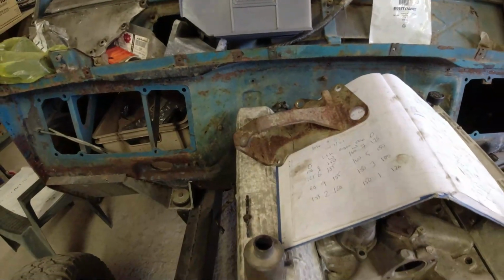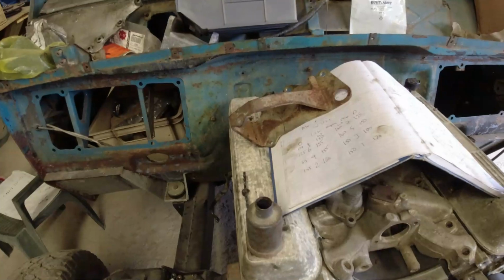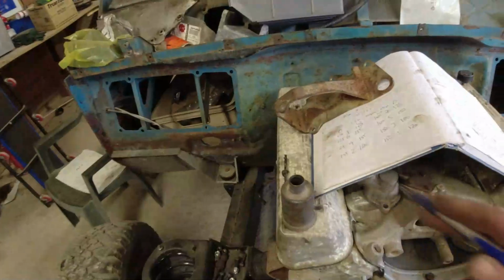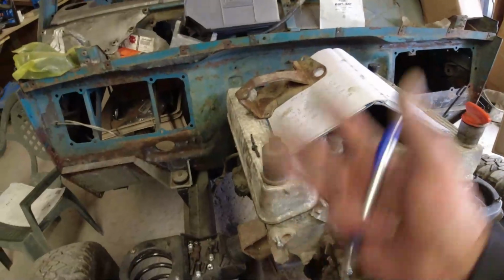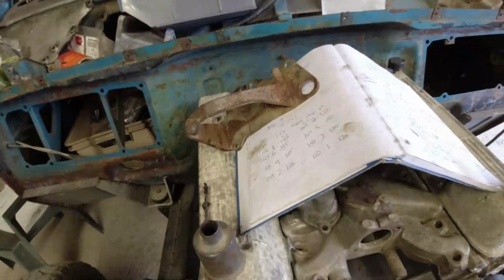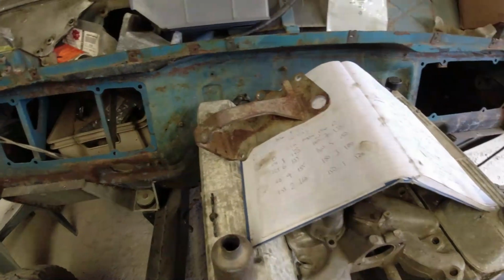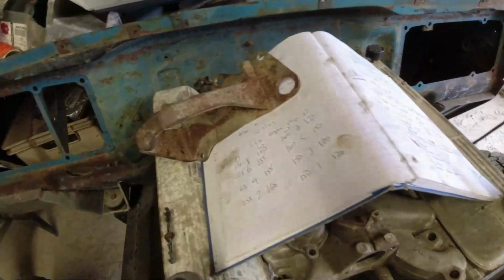So then I thought, well, maybe, just maybe, there's a dusting of rust on each of the bores. Those pistons that were right at the very top are reading very well, and those that were right at the very bottom were reading a little bit more poorly because they had a little bit more dusting of rust to get rid of.